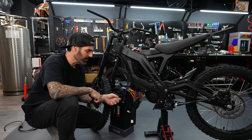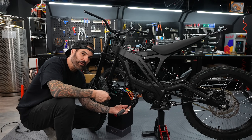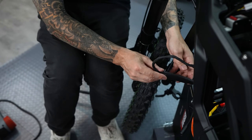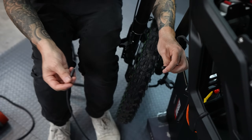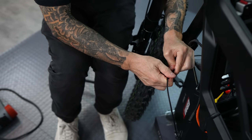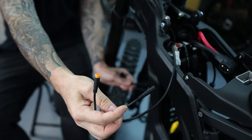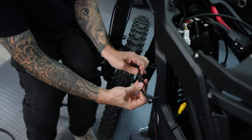After heat shrinking all the connectors in the neck of the bike, I still need to shrink wrap the empty connectors down where I removed the kickstand and tilt sensors. I plugged the main harness into the connector on the controller and heat shrinked it — there's a little screw terminal you need to make sure is tight. The Bluetooth dongle just needs the notches and arrows lined up on top. Then the last connector mounts to the two-in-one and routes up through the top of the bike — line up the arrows and the notch inside.